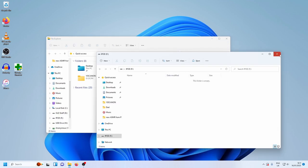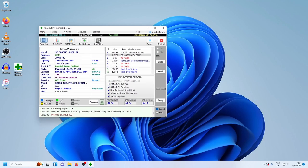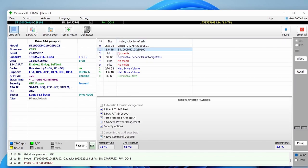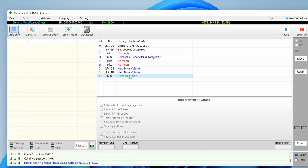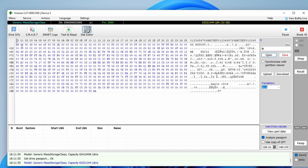What you should do is go into the hex editor — Victoria is the easiest one, it's a two-meg file, it's tiny. Look in here for your removable drive. Mine is 32 gigs. You'll see one that's physical and one that's logical — either way, you want to choose the one that's got a drive number. So on number three, get a disk editor, open it up. You'll see 'EB' is the first byte — you want to change that to zero zero, just click on it and hit save.